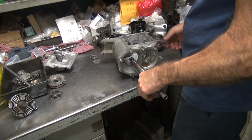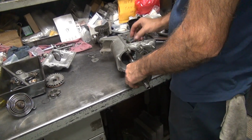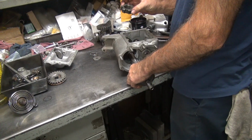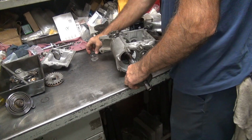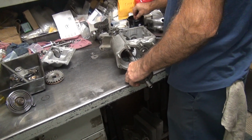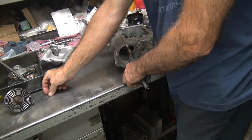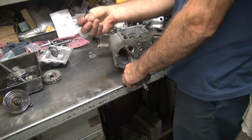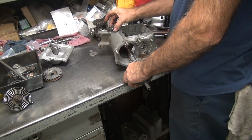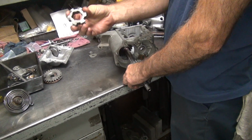Alright. I'm gonna put the third gear in here now. You better. And then put the other, wait a minute. You want me to put the dog in there too? Yeah, and make sure it says AP? HC, yeah. You think I should put the washer in there? Yeah. You definitely need the washer and the snap ring. Oh, that too. Well, you can spread that out and put it on later, right? I don't think so. I've seen people try, but it don't work. Okay, so you gotta put that on there now too. And you gotta put the AP on the out, because they don't have anything on this side that says high. Right.